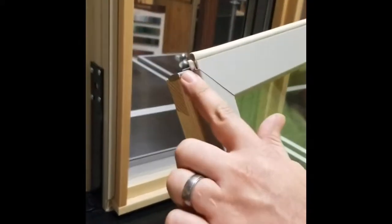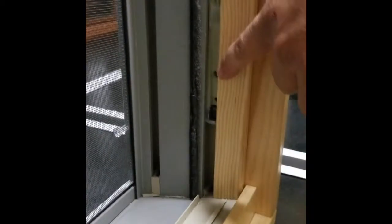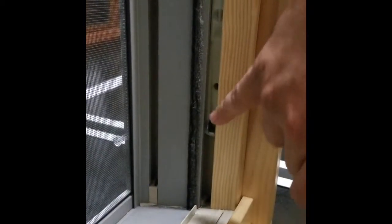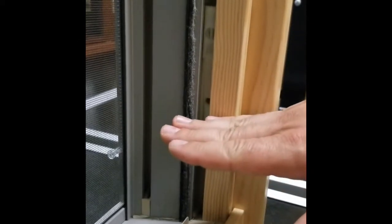The reason being, these guys here and the little ears — if you can look in here, they go into this pocket. But if you try to lift them up without raising both at the same time, one of them will catch in that little hole, and it makes it hard to come out. So you've got to raise just a hair, and then start to pull them out.